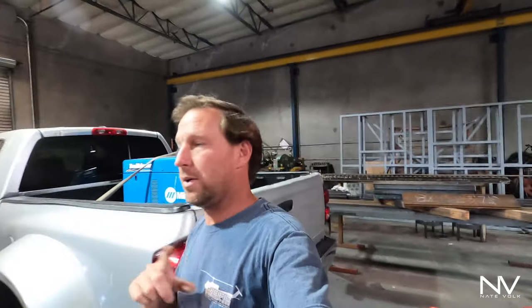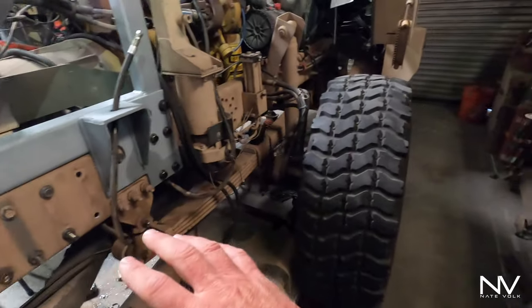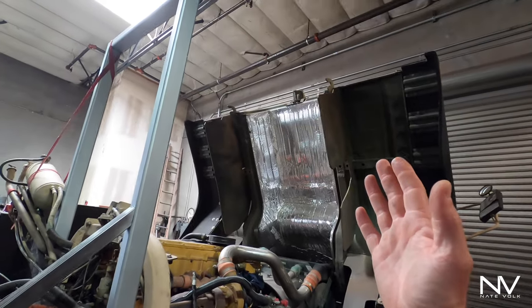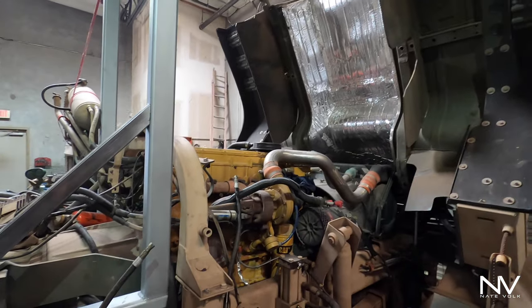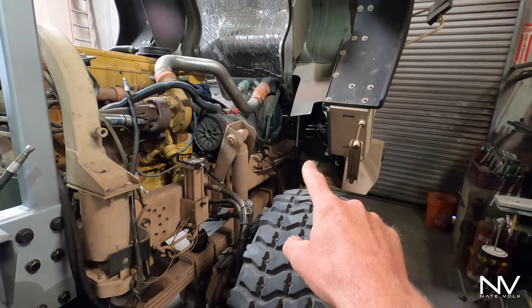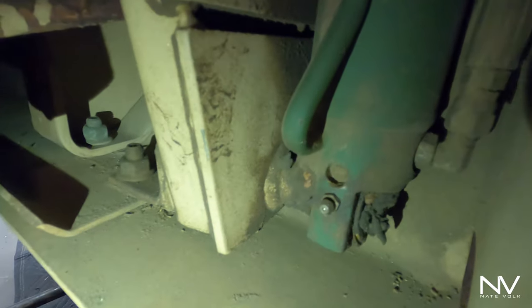Hopefully by Friday we'll have another update. On the cab tilt — this is interesting. I hooked up this hydraulic pump, just hooked it up to a battery with a little pendant down there for control, and plumbed in some hoses real quick. The cab would start to come down super fast, then it would sort of lurch and stop, then I'd have to go up a little bit, then stop, then up a little bit — it was a pain. So there's a safety mechanism. It turned out that Quaid was nice enough to respond on Facebook and show me where this is.